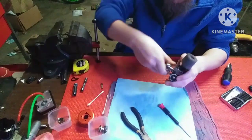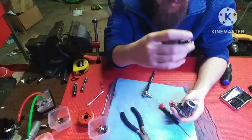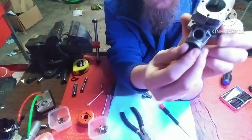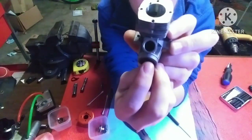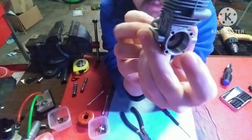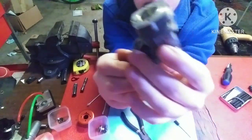And loosen the pinch bolt. And your carb should come out. If it doesn't come out that easy, heat up the block, keep twisting, and you get your carburetor off. Okay, then you can see down into the intake, and you can see how your crankshaft has a cutout time window, and when that opens is when the fuel goes into the bottom end, and while it's spinning, that picks up and goes to your transfer ports and whatnot.